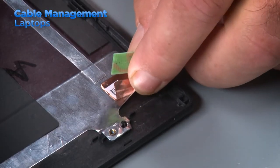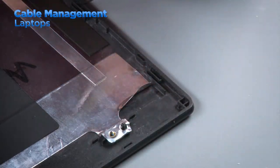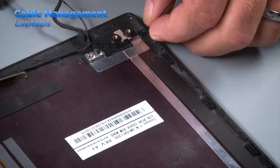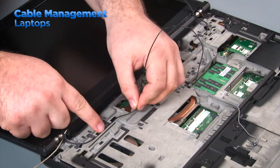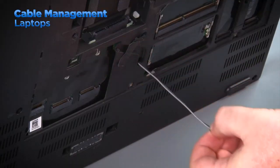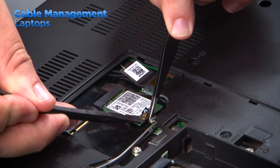Wireless LAN and wireless WAN antennas are generally secured to the top cover with an adhesive backing. The cables then follow a cable guide around the top, down the side, and around the bottom of the LCD panel. They usually go through a hinge assembly and into the base of the laptop. From there they are routed through another cable guide to their connection on the wireless card. On some laptops, the antenna cables will go through a hole and follow another cable guide to connect to a wireless card on the bottom of the system.